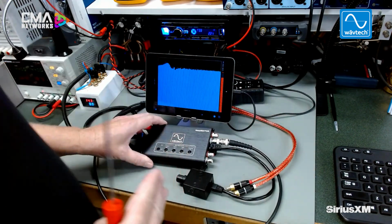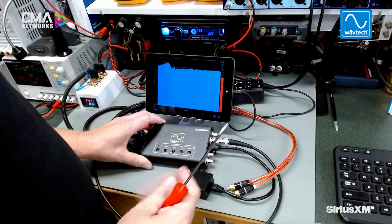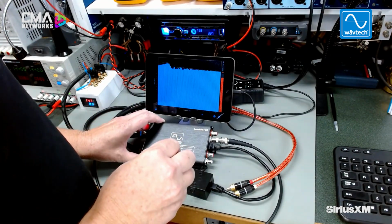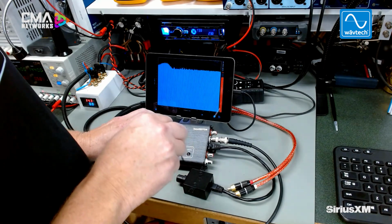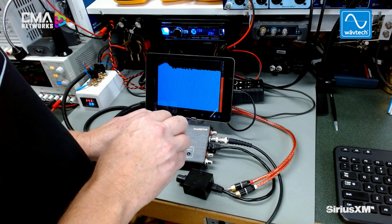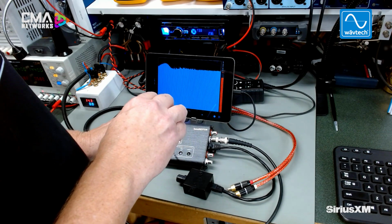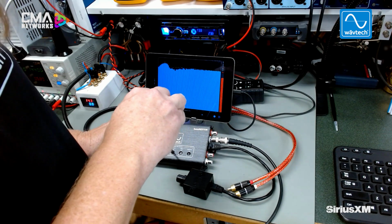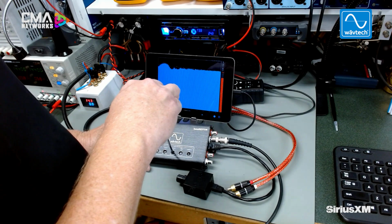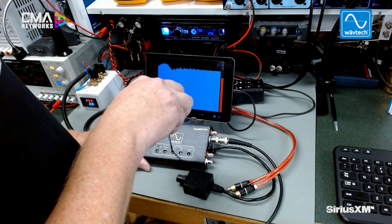If you're going to augment your music primarily and you have a flat frequency response, you're going to want to just put it to where you think that sounds best, which is usually right around the 40 hertz range or so, and the width just below medium or so. If you go narrow, you're going to have a much narrower effect. If you want just more punch, but you don't want a lot of low bass, then that would be the way to go.